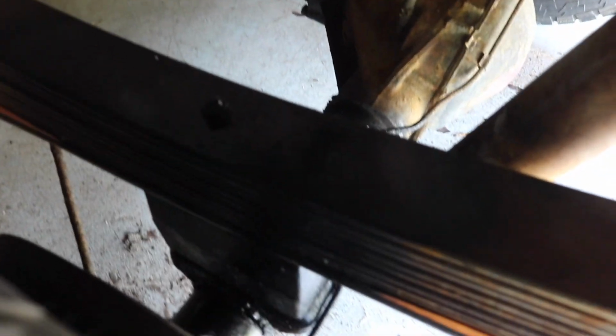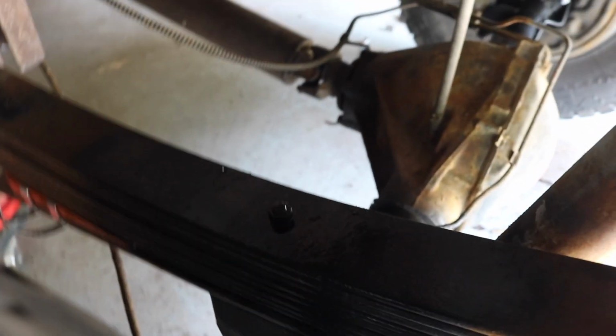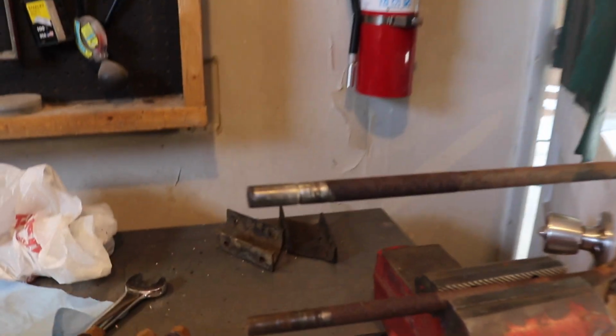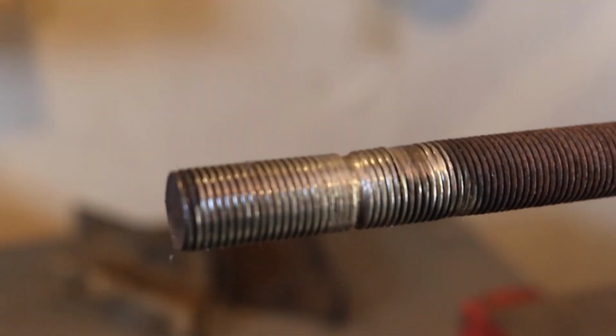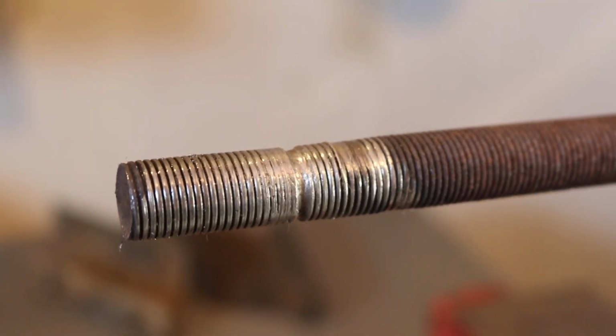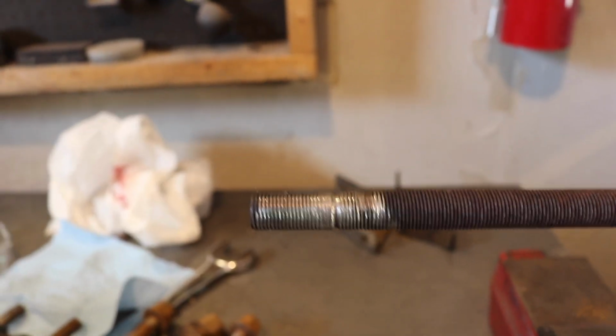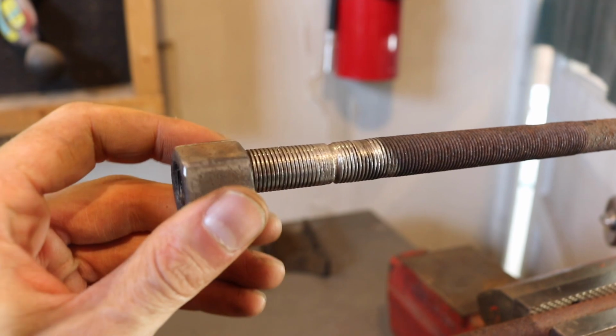And cleaned it with alcohol a little bit before. So got it painted. Now for the U-bolts, here's the story of why it was giving me such trouble. There was most likely corrosion on that U-bolt there, which messed up the threads. It also stripped the nut as well.